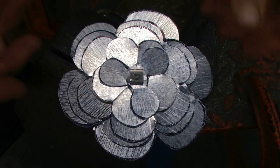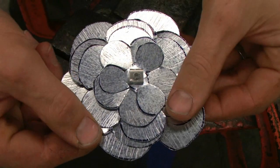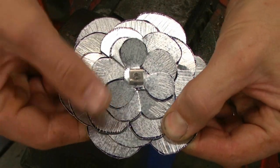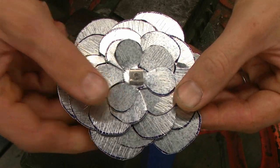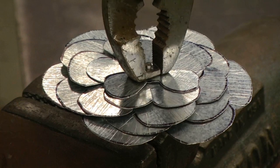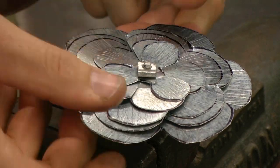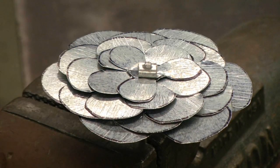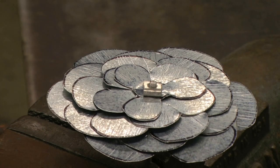The smallest piece will go last, followed by our second aluminum nut. Ideally we want to orient each of the petals so that the cut portions are offset from each other. You can use slip joint pliers to gently snug down that aluminum nut, but you need to be very careful because it is aluminum — if you over-tighten it you will strip the threads on either the nut or the galvanized tension wire.